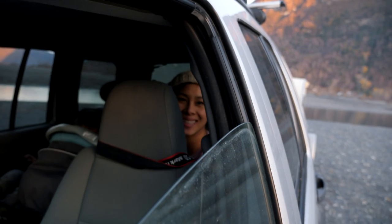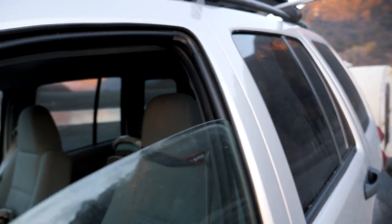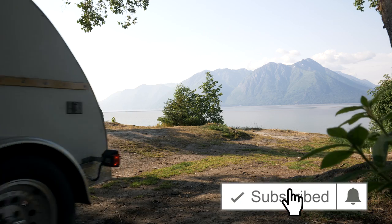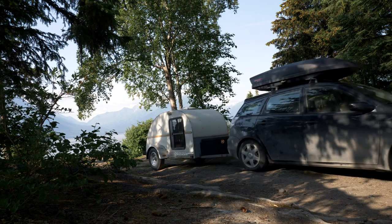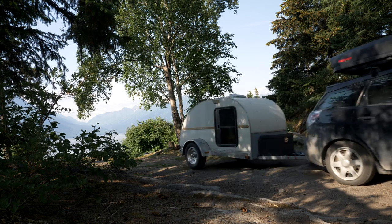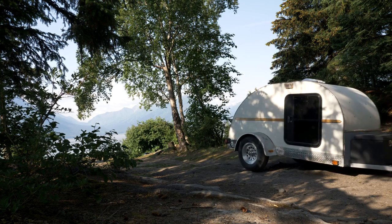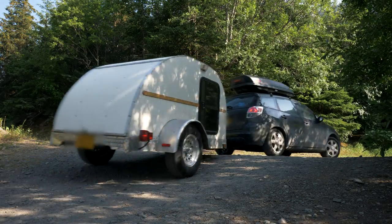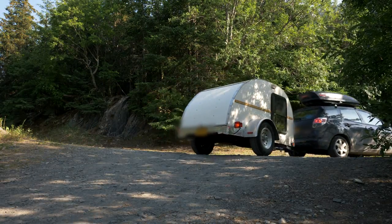I found — and I see this on many travel trailers — I wasn't actually bottoming out my trailer. What was happening when I was going into spots with dips and ruts, I was bottoming out my trailer tongue. I always thought my trailer was level, but just by raising the hitch a tiny bit I no longer bottomed out in rough conditions on the trail.